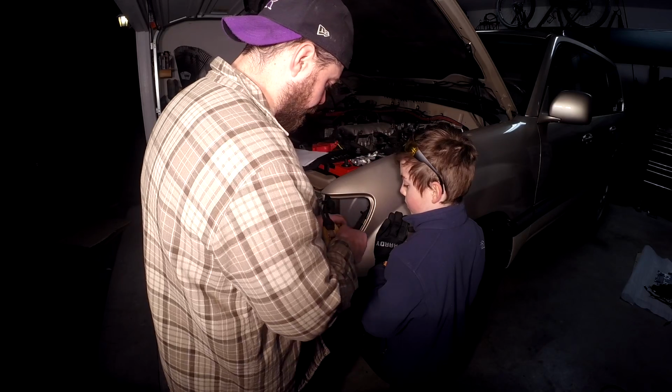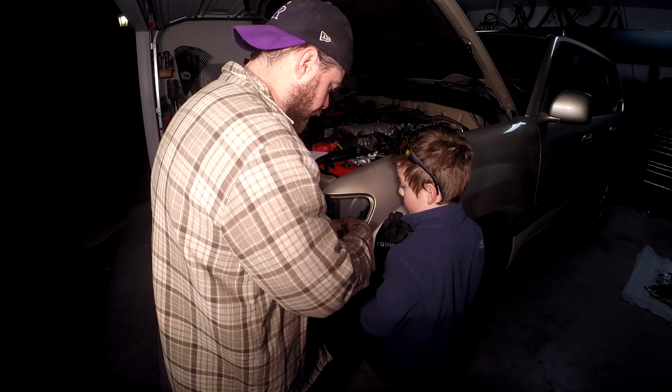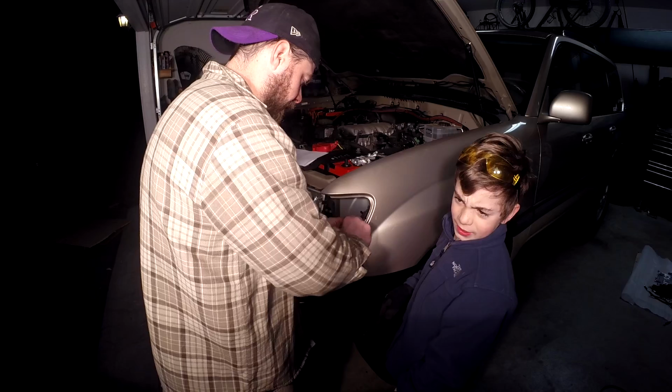The Fuzz on I Hate Mud ran a separate ground, so that way, if one ground went bad, you would still have a signal light, one of the two. And that's actually not a bad idea, but I decided not to do that. We used crimp connectors, solder, and shrink wrap for the signal light wiring. I think a better solution would be to use some of the Bosch connectors that you can get on Amazon. I'll throw a link in the description to those below.